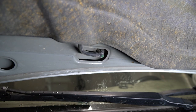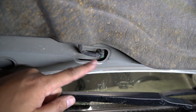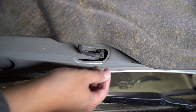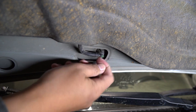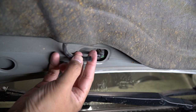We are on the passenger side here and you can see this is one of the nozzles attached to the hood — it's exactly the same on the driver's side. You're going to want to disconnect this hose here, and be a little careful because it is old. You might want to take a pick and put it in there to try to break it free. Mine just pulled right out, but if yours doesn't, make sure you use a pick.